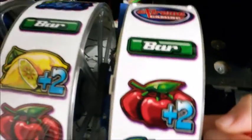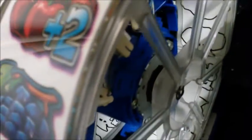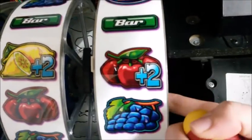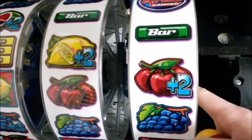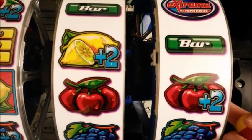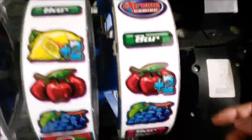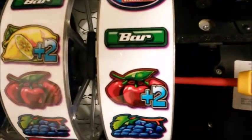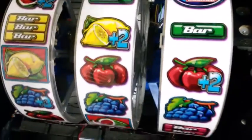All you're going to do is move this blue tab here. You're just going to move that and look at your reels, and push it up until it doesn't adjust anymore. Sorry — it goes this way; my error. You have to line this up. You need to try and line it up — preferably with the fruits lined up. In other words, if you've got bar bar bars, try and use those to line up. If you haven't, just use the fruit below it. You can get a rough idea. Then you're going to tighten it back up.